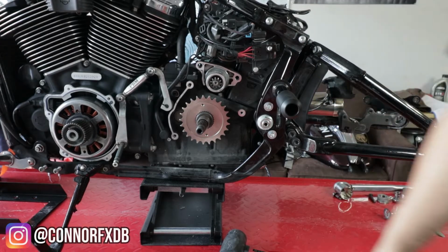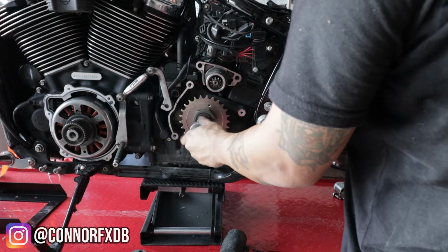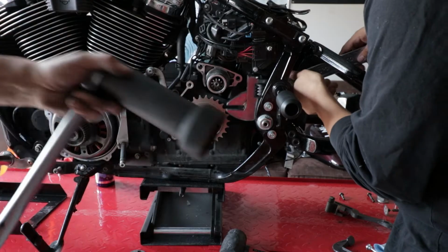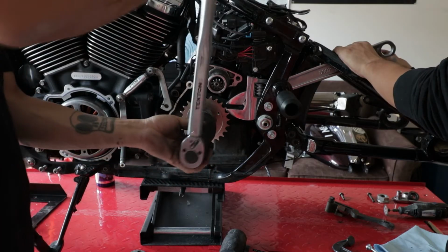Where's that red Loctite at? Now we're gonna torque it with the impact. And on the M8s, it is a right-hand thread. The manual states 100 foot-pounds of torque initial, followed by 35 foot-pounds. So I think we definitely got the 100. Yeah, that's pretty much as it goes.